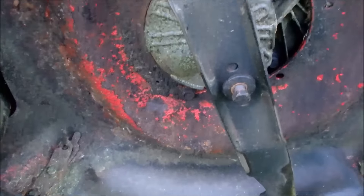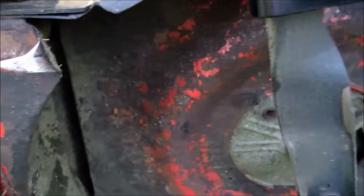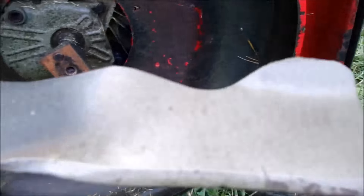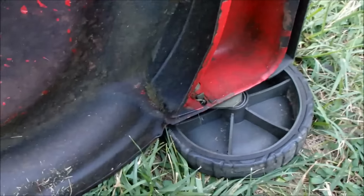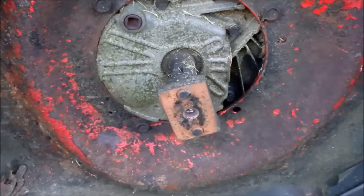I did sharpen the blade on this. Taking the blade off the snapper here — going to sharpen it. The bolt came out; I don't think this blade's ever been off. See if I can bend this back as well. This blade is not too bad. I'll do a sharpen and balance on it. The blade looks good now, got a little edge on it. Also had to take a little metal off the back here to make it be in balance, but it's as good as it's going to get now. The blade actually was in good shape.